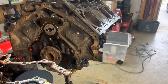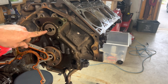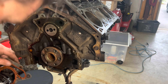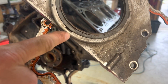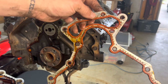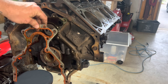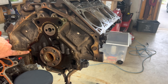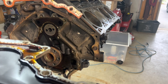Here is the gasket. There's the back side - you can see the back side of the camshaft. The biggest thing I got to do is get that seal out of here. This is the rear main seal that goes in this cover. It's infamously leaky, but look at that - that thing hasn't seen a drop of oil, which is great. But I have it and I want to replace it. I'm going to clean this cover up. I have the new gasket for the rear of the motor. You can see this is similar to the front - it had a crossover port, and that's for your lifters, that's your oil port for your lifters. We'll clean this up with brake cleaner, put a little pan down below to catch some of that stuff.